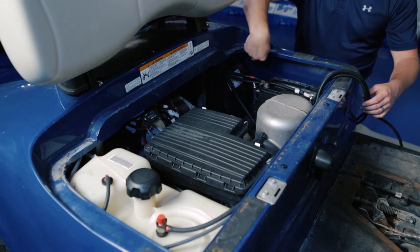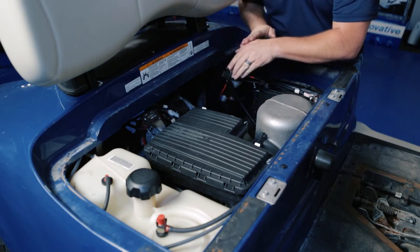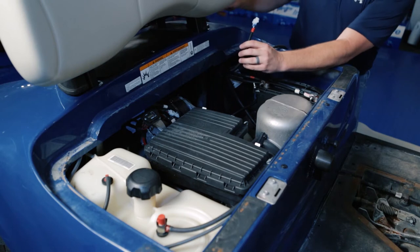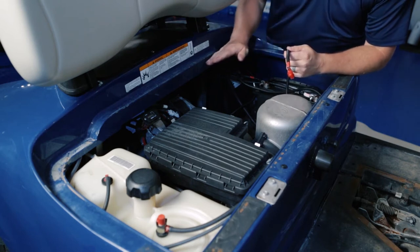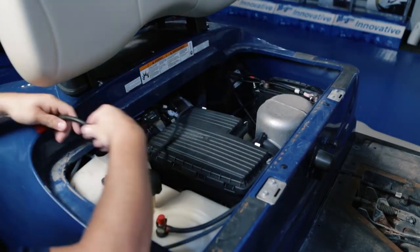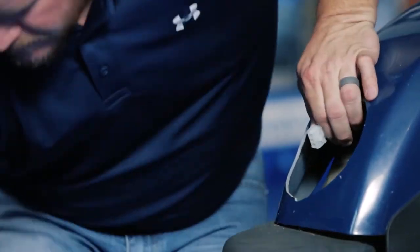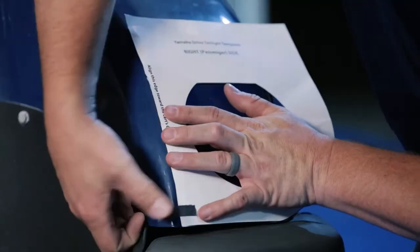You're going to feed your harness around the outside battery on the driver side here. You're going to leave your battery converter hookup here at the back of the cart. You're going to take the white connector and feed that over the rear panel of the driver side. Then you're going to run the passenger side red connector behind your motor or your battery pack across the back. We'll secure it later and then over the passenger side of the cart. Now we're going to pull our tail light harness over the rear tire well and attach our tail light. Finally, we're going to secure the tail light to the rear body using the supplied hardware. We're going to repeat this process on the other side.